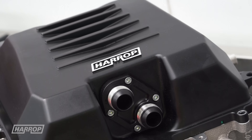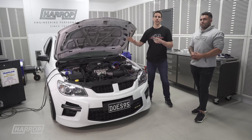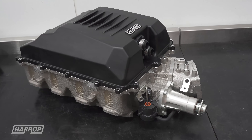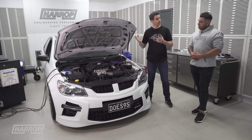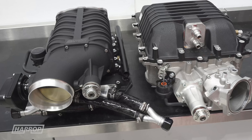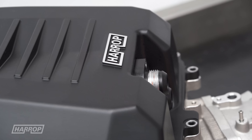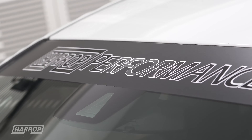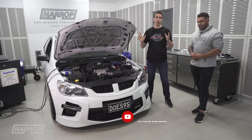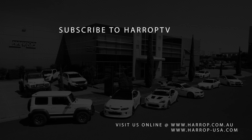It's a fantastic combo, there's absolutely no doubt about that. I know a lot of our followers are massively impressed by the car. We have teased an image on social media of the Harrop lid that's got a Harrop core inside. It is physically larger than the LSA unit. It specifically suits the VF platform which the HSVs use with the LSA engine. The factory LSA lid and core does hold it back a little bit — there's a little bit of restriction in there. Your Harrop lid is showing some form of gain already. So lots of new combos to share. We're going to get them onto the car. It does nines — there's no question there's more potential on the track, but until the track's open, we'll keep on dyno testing and share the results on Harrop TV.